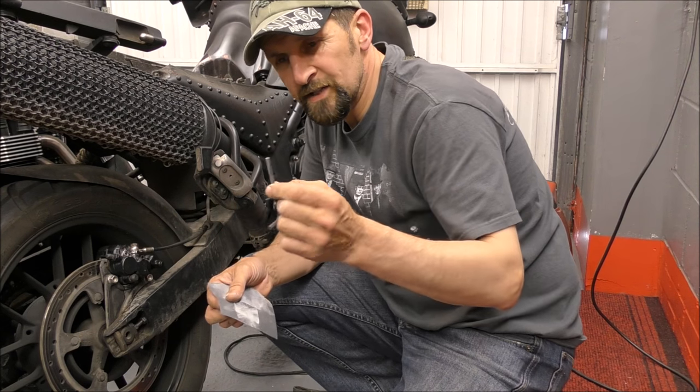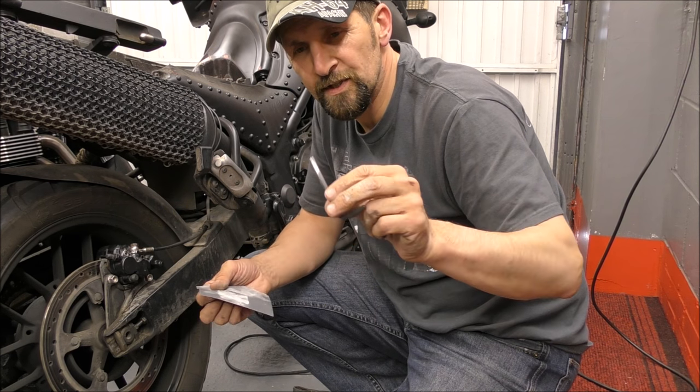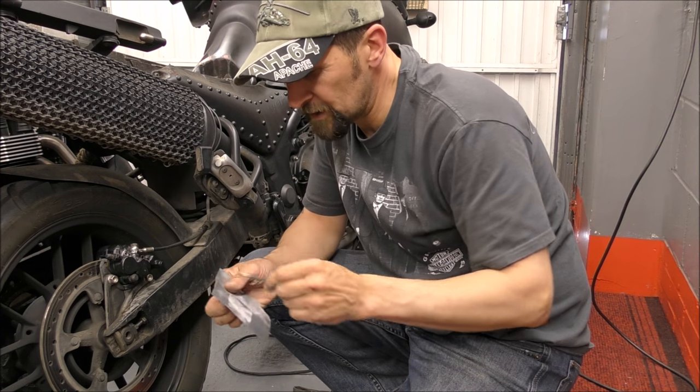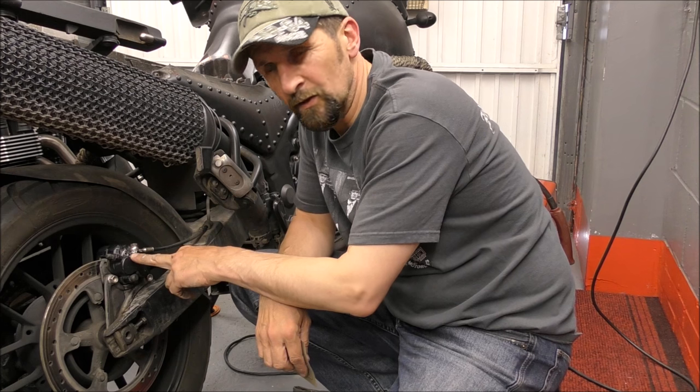Clean off as much of the residue as you can. All tools come with a kind of protective residue on them. Clean all that off first, because you're going to weld it, and obviously you can't weld through it. It's going to be a bad weld and then you'll defeat the object. So clean that up. Again, you've got to be quite apocalyptic on this, really.